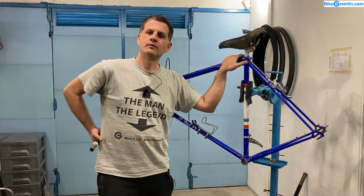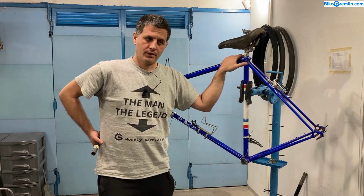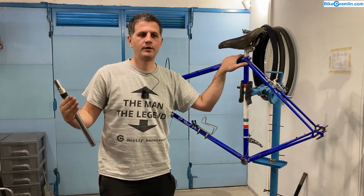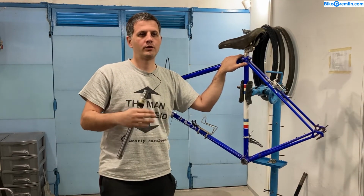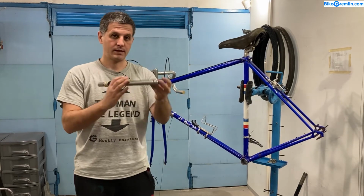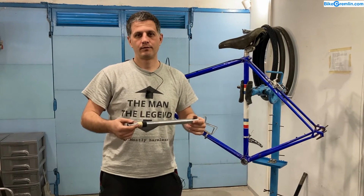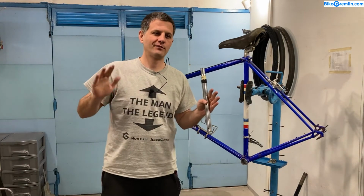And about aluminium frames, that's what I also got asked. Can I ride an aluminium frame if I'm over 150 kilograms? Inherently, frame materials don't make a difference. You can make a frame that is durable and strong out of any material, and you can make a frame that is weak and bad out of any material. So a steel frame is not always stronger than aluminium or carbon fiber just because it is steel. It can be stronger or it can be weaker depending on these things that I explained. I will also put a link to my article explaining bicycle frame materials, all their pros and cons, about the most popular materials used. But here is just a short version.